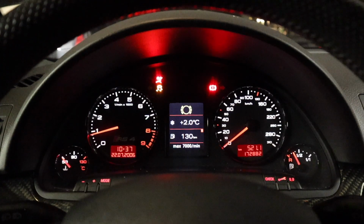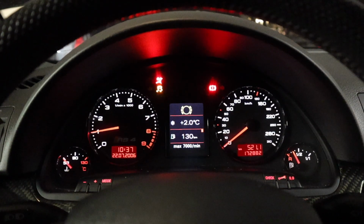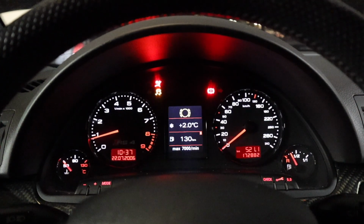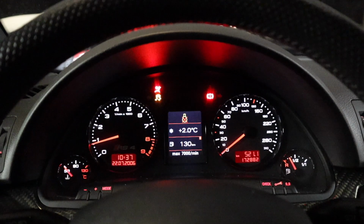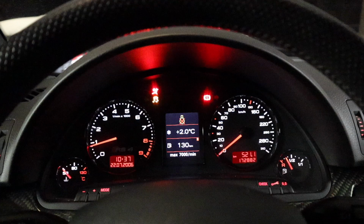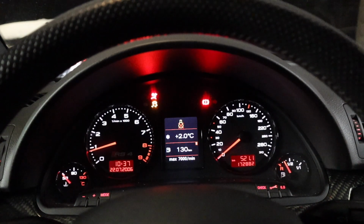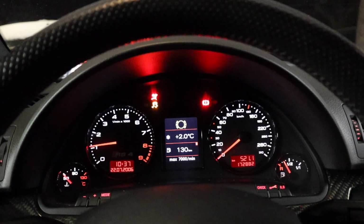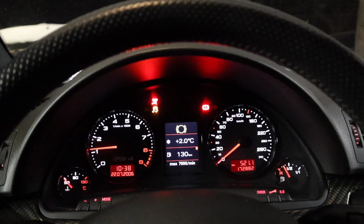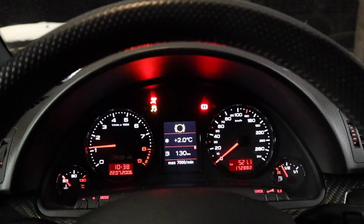Now, while we wait here, the traction control light could go away on its own with some driving. One Instagram person told me that worked for them. And also, if you remember in Put Back Part 8, the traction control light was half working, like it was off, and I could turn traction on and off. So this might be odd, but the traction control light system is mostly ABS and brake light switch related. We'll go over the circuitry of that at another point, or you can just read up on it. So the brake light switch, pedal switch, whichever one it is, I'm not going to change for now. We're just going to change the bulbs, although I don't think they have much relation.